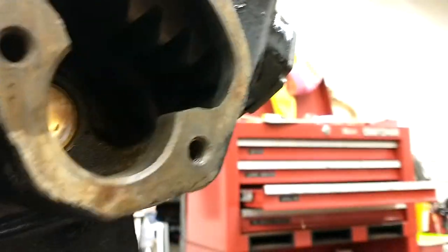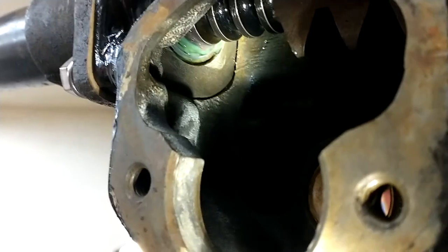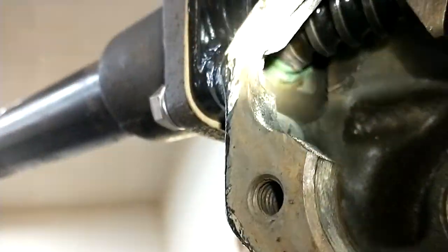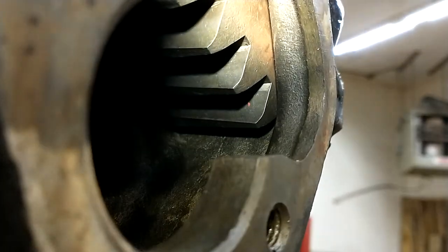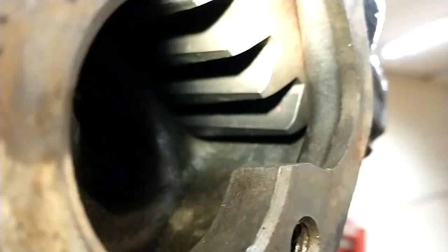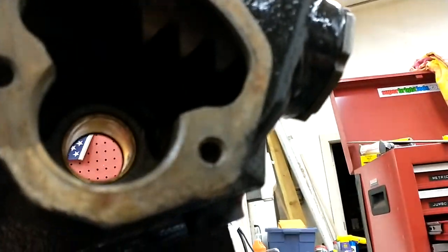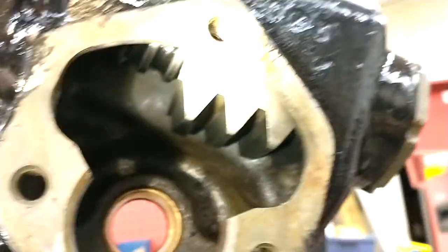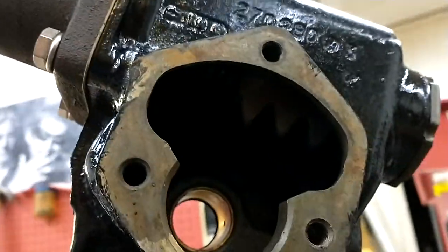I got the worm gear bearings in. One thing you want to make sure of is that they stay flush — it's nice and flush inside the case. When I was putting the cap on, I let it wiggle around too much and it got cocked in the cap. What helped was putting the bearing up against the end of the worm gear and turning it while keeping pressure so it didn't allow it to turn inside the case. Then you just crank it down gently by hand until it stops, because you do have to go back and adjust it later using a scale — you set the preload and all that.